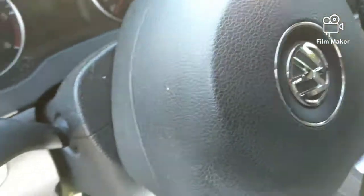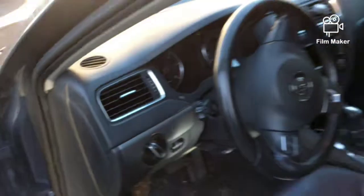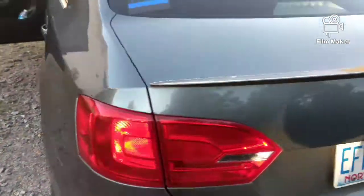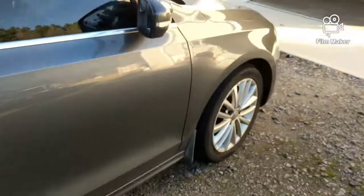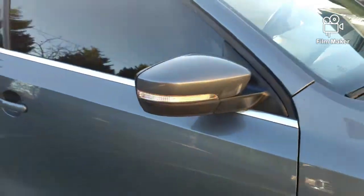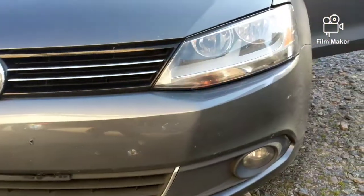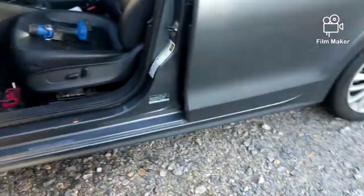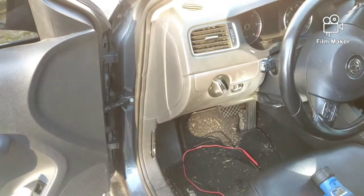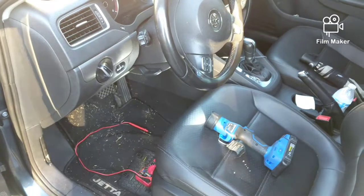Let me hit that button — I got the lights blinking. There it is, that one's blinking. The ones on the mirrors — I forgot those things there. Got that one and that one. So now those are working, and it should be the same fuse for your brakes. Just go ahead and have somebody hit the brakes and you look at it. But thanks for watching, hope it helps.